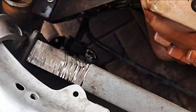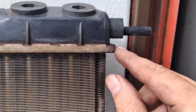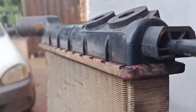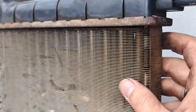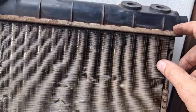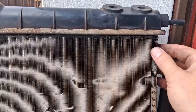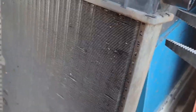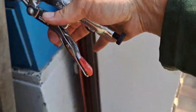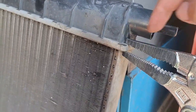The next step is to remove the radiator. I inspected it for obvious signs of damage but couldn't find any. It's leaking at the top end where the tank connects to the core. I thought I'd try tightening the clamps with pliers or a vice grip — maybe they were too loose. There was also a spot at the bottom where it looked like a stone hit it, which was a second leak point. I adjusted my vice grip to a nice tight setting and went through all the clamps, re-clamping and making sure they're all nice and close.